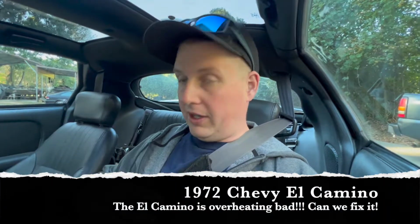Okay, so the El Camino is broke down. The owner said it started overheating at like 250 degrees, so hopefully nothing's hurt. I had to bet. It has a Mark 8 fan, like a 100 amp relay, and the controller's off of the Holley. I'm hoping it's a fuse, but I don't think it's a fuse. I think it's the motor.